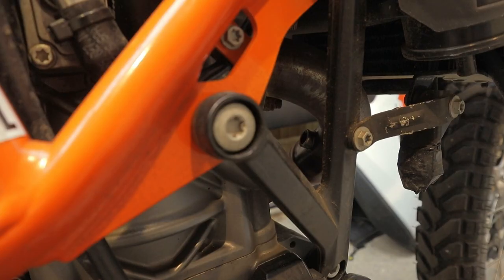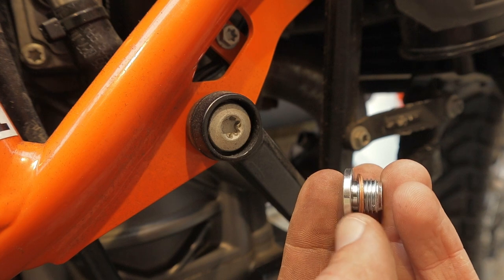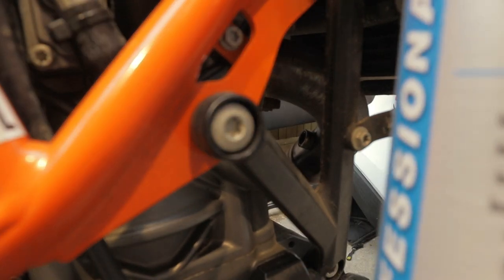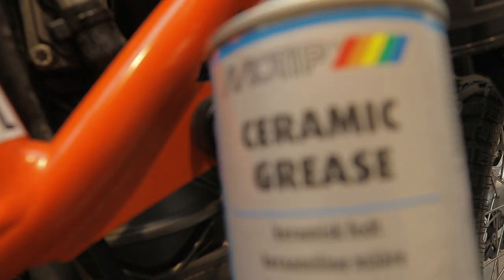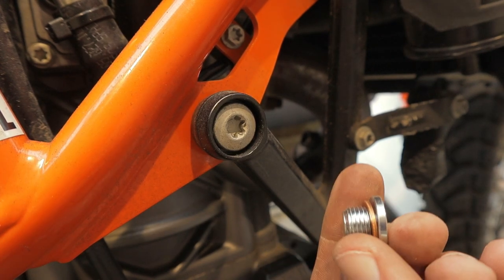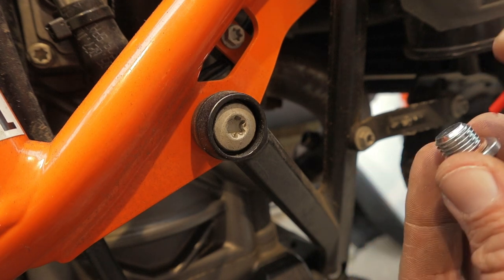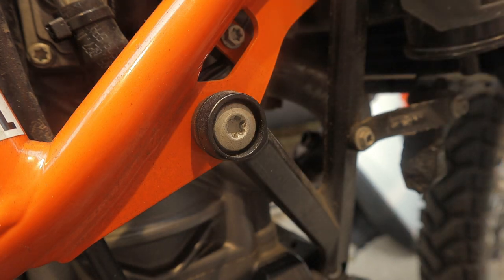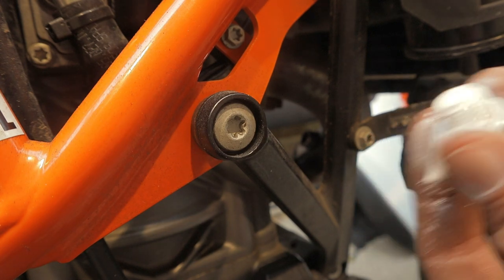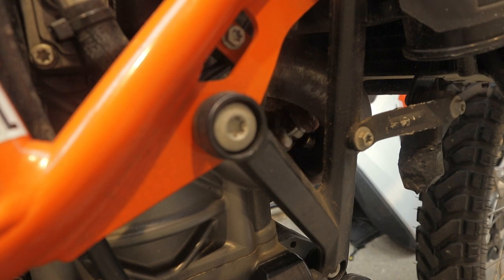I took the O2 bung plug in mild steel — you can get it in titanium and other materials too. It has a little copper gasket. What I like to do is apply some ceramic grease, which can handle high temperatures, so it won't get absolutely stuck in the exhaust and impossible to remove later. Give it a good amount of grease, and then let's get this thing in the hole. I'll screw it in by hand first.